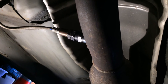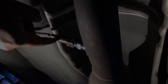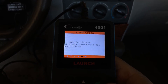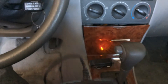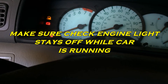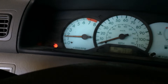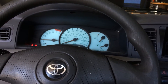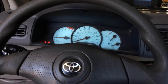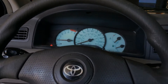The next step is to go up top and clear the P0420 code, then drive around and see if the spacer takes care of that code. I'll let you know either way. Emission related diagnostic information has been cleared. Check engine light is off — now we just need to drive the vehicle around to reset all the systems. Hopefully the check engine light stays off. This will be a great fix if it actually gets rid of the P0420.